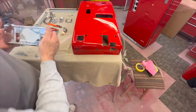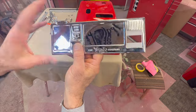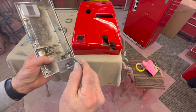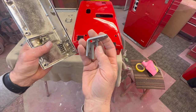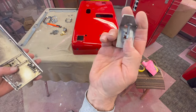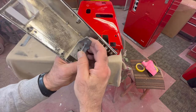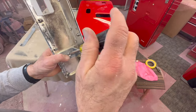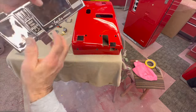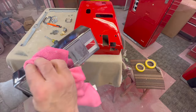The second part — you'll have the coin release piece that goes in. Turn that around. When you put this in, the stem piece needs to be in the down position. This piece here is what is going to be going against the coin rejector, so that'll be your adjustment. This will bolt up right on the back there — get that pretty squared up when you're doing it. The chrome just really came out good.